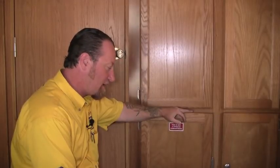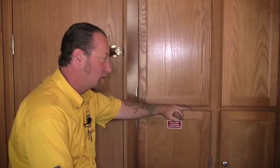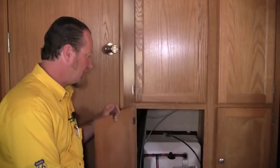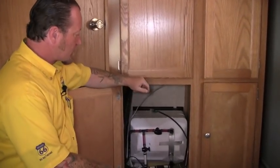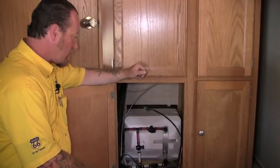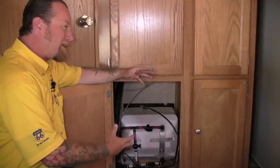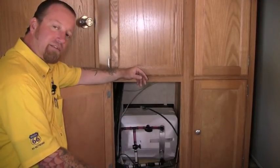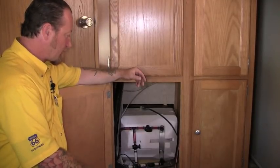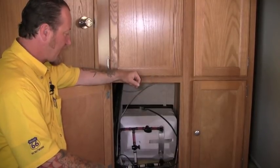After we've dumped our hot water heater from the outside of the unit, we want to use that approximate location to find the back of the hot water heater inside the unit. This particular one is located in this cabinet. What the water heater bypass does — when you access the back of the hot water heater you'll see a series of valves or maybe one valve. We don't want to put six gallons of antifreeze into that hot water heater tank, so we want to connect the hot and cold plumbing lines together so we can winterize both sides without filling up that tank.